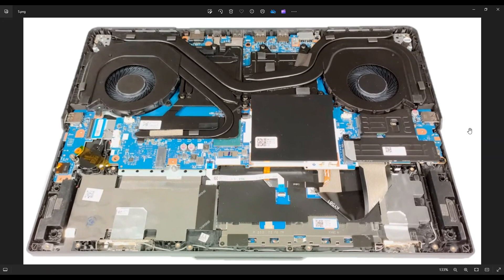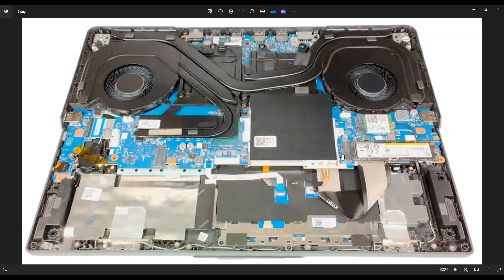Now that the battery has been removed or unplugged, we can proceed deeper into the computer. The next thing is your storage — your solid state drives. The first M.2 solid state drive port was right here under that metal guard we already removed, for one of the shorter solid state drives. Your next M.2 port is under this guard on this side — remove three screws and that reveals the port for one of the longer solid state drives. To remove a drive, undo the single retention screw and slide it out. These slots take either 2242 or 2280 Gen 4 solid state drives. I'll have 500GB, 1TB, and 2TB upgrade options in the link below.